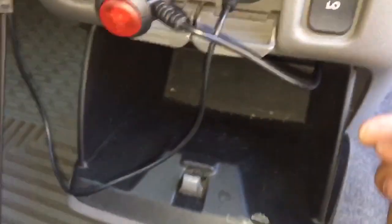I got some success — I was able to push the wire above this compartment and have it go in the back, and I can pull that wire from here, which is nice. Now I can really hide this wire. Also, if you need to change your AC or cabin air filter, the filter is right behind the glove box. So we're going to open this up — push this back, release it from the little groove here, and use a screwdriver to pop it open.